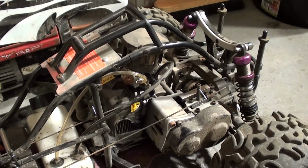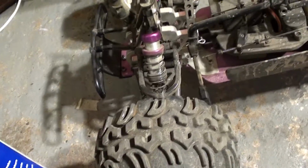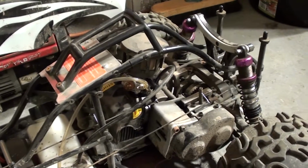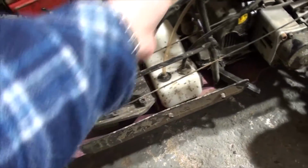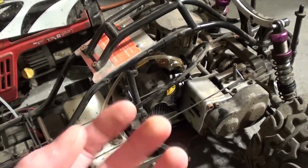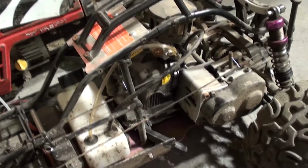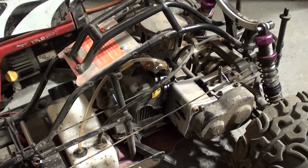But I've been watching a few videos on YouTube, and people don't seem to be oiling things and don't treat their trucks, don't treat their engines well. Don't let them warm up or nothing, and driving them through big puddles, and the water's spraying up. They do it without their shells on. It's bad enough with the shell on, but without it, it's all spraying up here and there, going in the electrics, which on these particular trucks ain't waterproof either. And then going in the air filter, and the truck's dying, making that noise. When you rev it, it dies, because the water's getting in, simple as that.